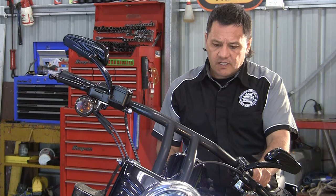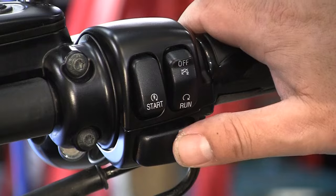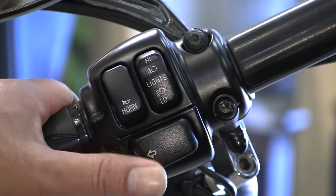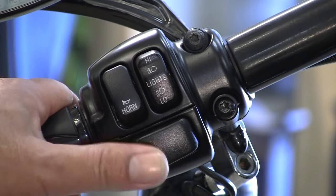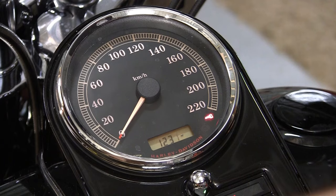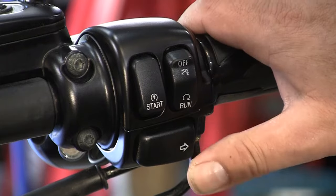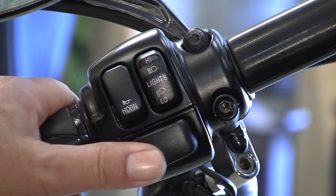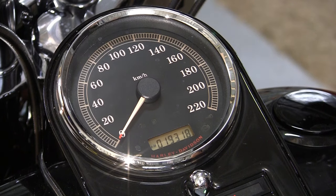And that's simple. Enter the PIN: first digit — 1, 2; second digit — 1, 2, 3; enter. Third digit — 1, 2, 3, 4; enter. Fourth digit — 1, 2, 3, 4, 5; enter. Come back to the speedo — now we can start the bike.